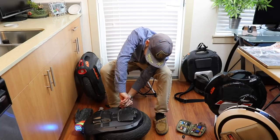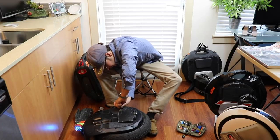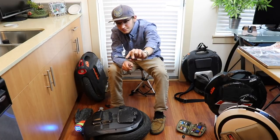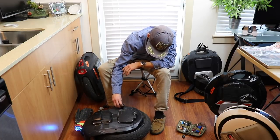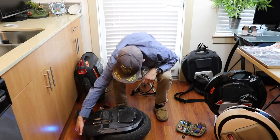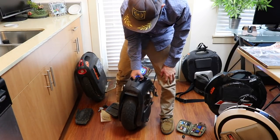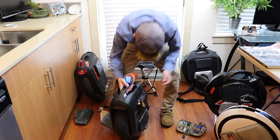When I first got this thing, it felt like I was dropping a rock on the ground — but now it just kind of bounces. So that's the PSI I've got in there and it feels perfect. I took a bunch of field notes. My weight is 120 pounds — so tire pressure: 10 PSI for 120 pounds. I wrote in here that you need to carry a pump with you. For this wheel I think they should ship a small pump in the package. Going off-road you can deflate your tire for grip and off-roading ability, and then pump it back up for range on the bike path.